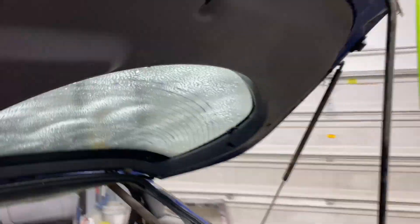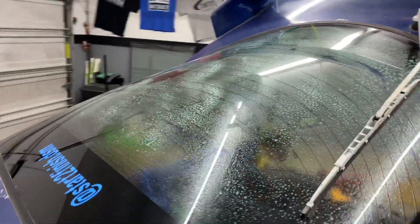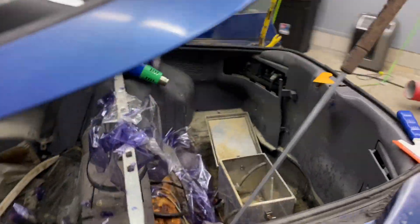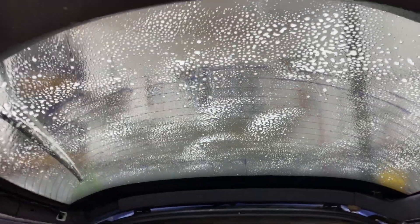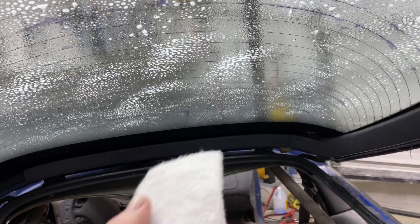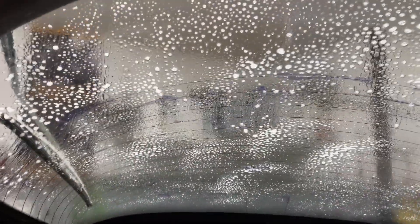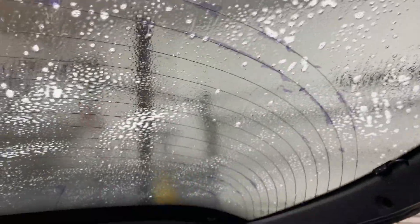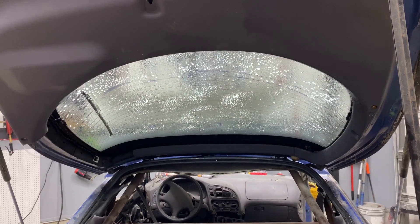We're going to let that sit for a second. I got about 98% of it off with the steamer — there it all is down there, nice purple film. And now we're just going to clean up the adhesive glue and the last of the film that's left stuck in spots. You want to grab yourself a non-scratch pad — this is a white scratch pad for window tinting. Another thing you can grab is a non-scratch pad from the kitchen section of sponges — the blue sponges that say non-scratch. Don't get the green scotch pads, make sure they're blue. We're going to scrub all this off and get it back to crystal clear.